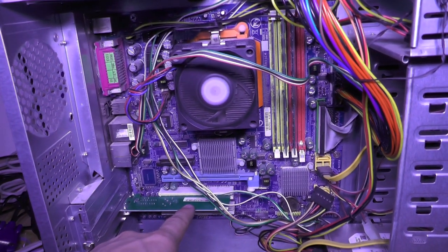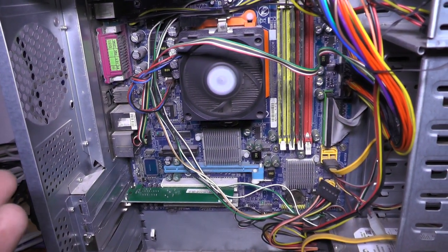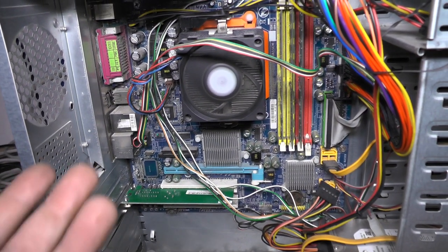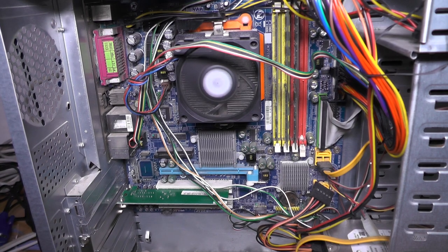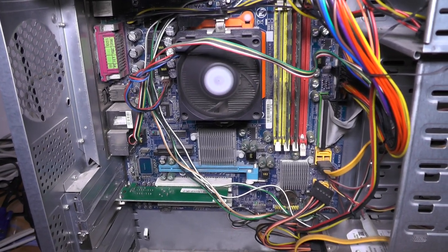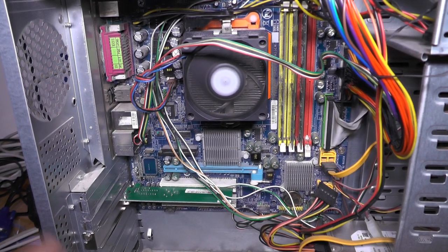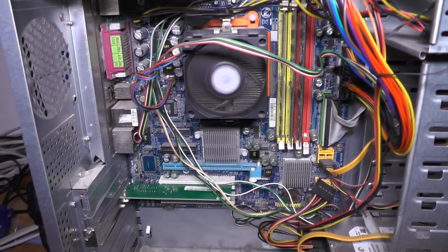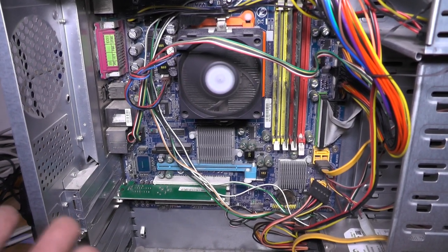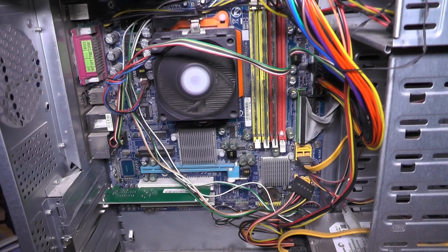If you have this type of external card, I would say PCI card, that means that at one time in this motherboard's life, or any motherboard's life, thunder has struck the router and the LAN port got burned. So this is, believe it or not, not that uncommon a problem. And basically the repair is simple. You can remove this thing without any professional equipment, even with a heat gun for paint removal. Bear in mind the heat gun for paint removal is not the best tool for such a job, but as I said, it is a relatively easy repair. So there you have it. This is working and I can return this thing to my friend. I will be cleaning it because it is bloody dirty.